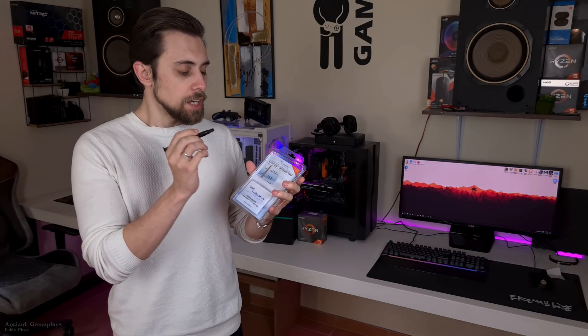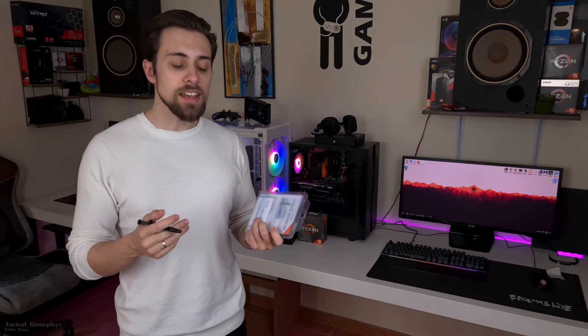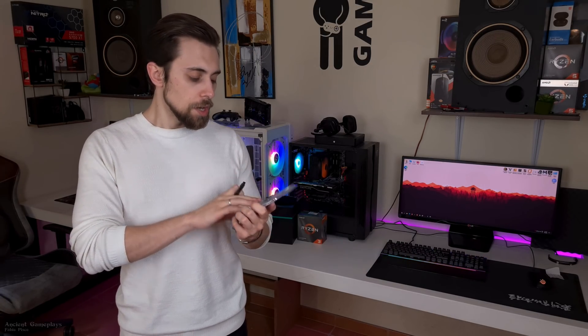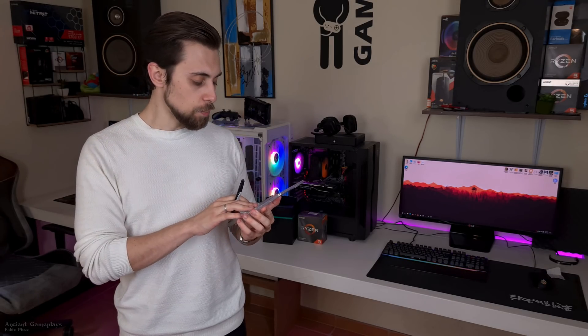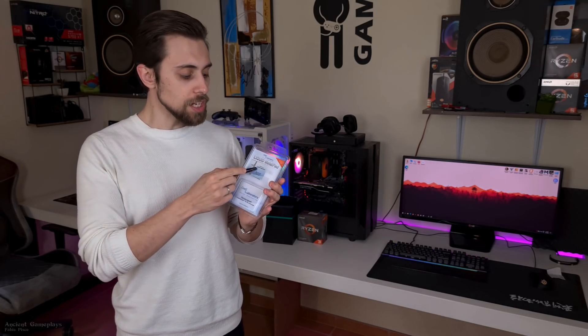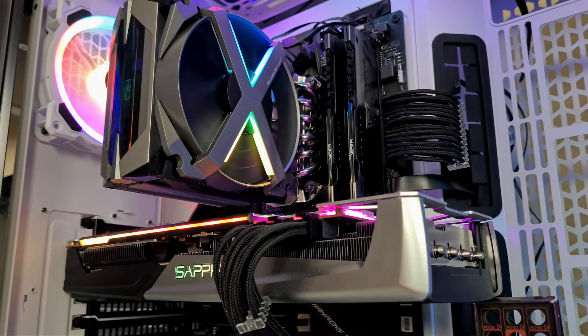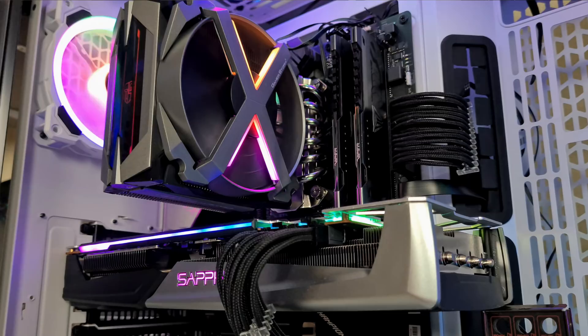If you really insist on buying these metal pads — in the name of science like I did — go ahead and test it for about a week to see if temperatures really go down. I think with enough heat it will melt and become liquid metal, but that leads to the second downside: if you're using liquid metal and you don't have a copper heatsink — if you have aluminum instead — the liquid metal will corrode and eat away at the aluminum. If you have copper, you're fine.